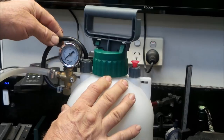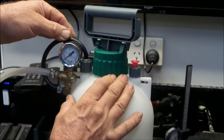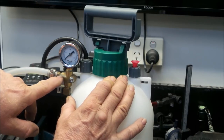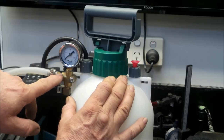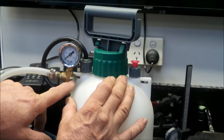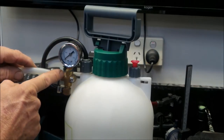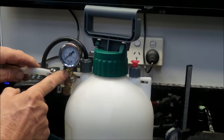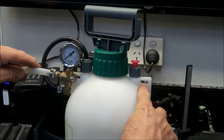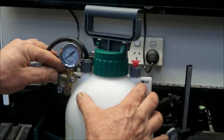Okay, so what we have here, this is the outlet that normally goes to the spraying wand from the pressure sprayer. So all I've done is basically cut that, and here I've mounted a brake line T fitting. The reason I've used a brake line T fitting is it has a hole to be able to mount it to a vehicle. You could use any type of T-fitting. This is 1/8 NPT, standard kind of fluid connectors, and I've just bolted it through, same area, just this slot that's on the other side. I think there's like a fabric handle or something that goes on there. That allows me to mount it.